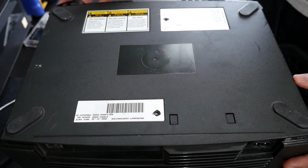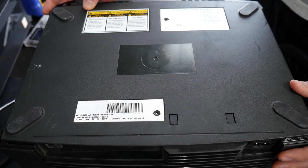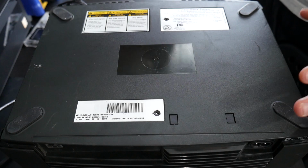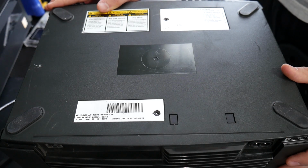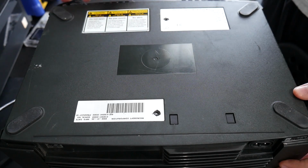So first of all, to perform some surgery on the system here, yes, we do have to open it up. For this, you do need to remove a few screws and move a few things to get everything sorted on here. First of all, in order to do this, you're going to need a T20 or Torx 20 bit. So make sure you have a kit available and make sure you have, the sizes will be Torx 10, 15, and 20. First, take your T20 bit and you're going to remove these 6 screws.